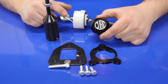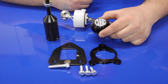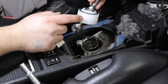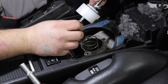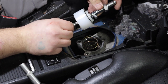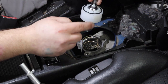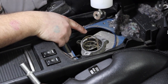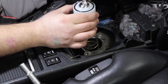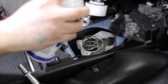We chose to go with the black shift knob with the silver machine lettering — it looks super awesome and will look great in the G35. Now we're going to grab the Cube shifter itself and drop it in. Be careful — there are two metal bushings that can fall out. Notice there's a little boss tab sticking off here; this is going to go right into position on the shifter. The metal reverse lockout is going to go towards the passenger side, so it will only go in one orientation. We're going to spray some grease on here.